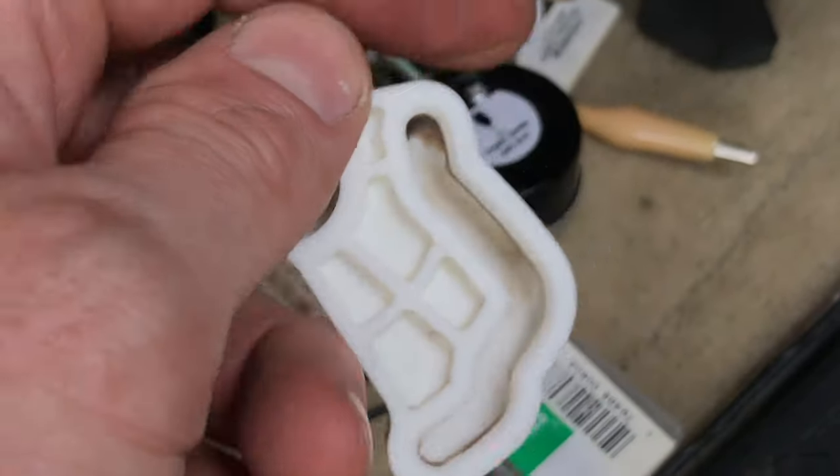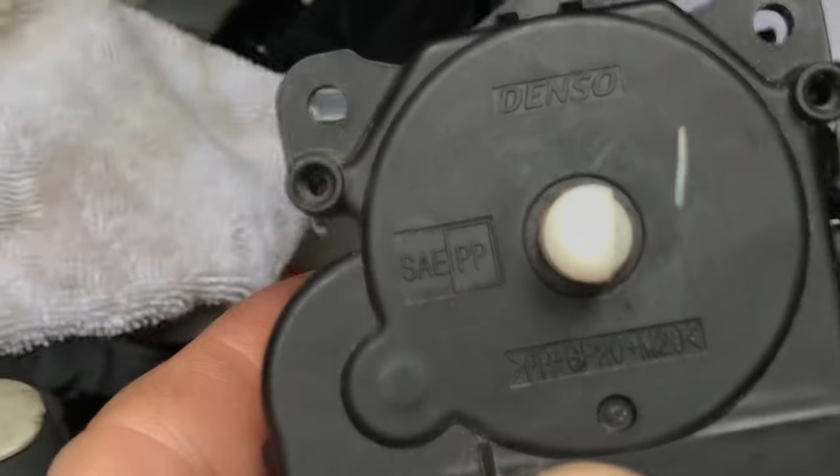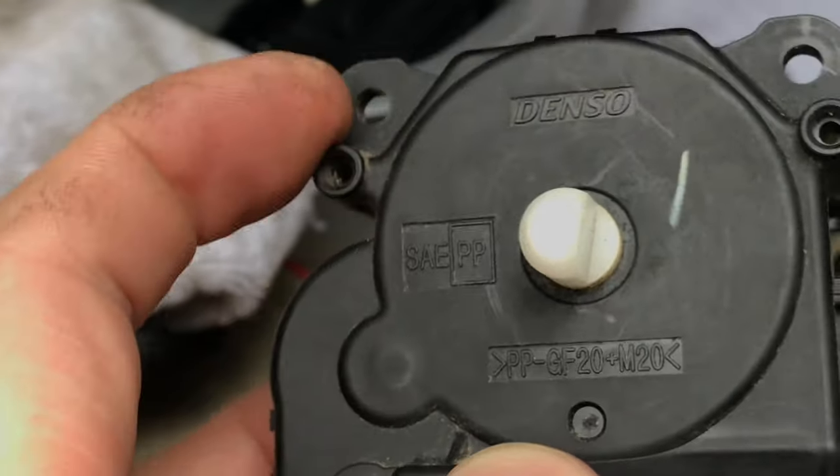What was happening: there's a little lever — the brighter white one connecting to the darker white piece — and I didn't have it in the right slot. I was over in the wrong position, so it was only pushing partially. When it came back, it wasn't engaging these tabs properly. Comparing the two servos, they're offset a little on the angle of the flat part.